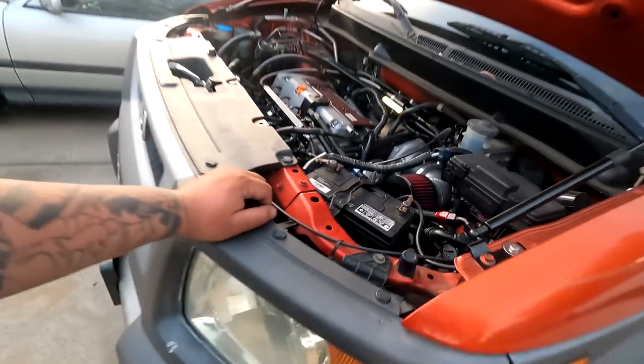Power wire and relay system for the Walbro 450 all said and done, fuel pressure regulator is adjusted. Hopefully the AFR is not too whacked out, and hopefully we get this thing on a dyno real soon. We didn't get to build the full PTFE feed line because of the fitting issue — we decided we're not going to run that line now. He can tune on E85 with the stock feed line that's in the car and then we can change the line after the fact.